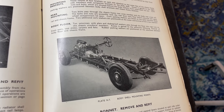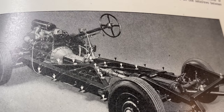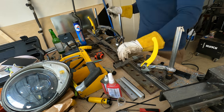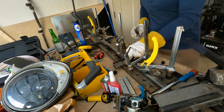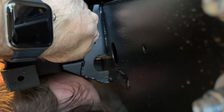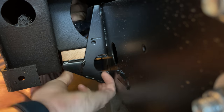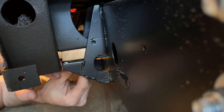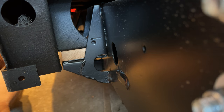The body is attached to the frame with four bolts on either side. There were another six on the inside that I took out when I cut out that big X-brace, but I'm trying to add them back in with this weird T-looking thing. I got it all welded up and started to put it in the car, but I realized I'd need to lift the body to get it in, tap a bunch of holes, and do a bunch of other stuff — and I probably don't need it, so I'll skip it. The outside bolts I definitely need, but the ones I made are too short. So I'm just going to use the old bolts — it'll only grab a couple of threads, but that's enough. The first two threads take most of the load anyway.